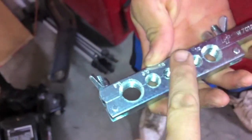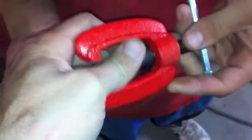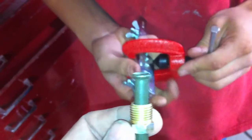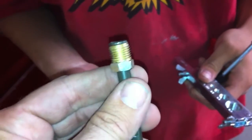Let's show what the flaring tool does. You clamp this around the pipe and cut it off flush with this piece of metal — those little ridges are so it grabs tightly onto the pipe. Then you take this piece, go through here like so, clamp down on it, and it flares out the pipe, trapping the pressure fitting in. Here is a fitting that is flared — that's what that piece creates. We had to cut it to get a sharper angle because the pressure line coming out of the C6 was touching the tunnel. We're pleased to report it's the correct size, it fits, and it's the same size for the small-block C6 we're prepping for the 351.